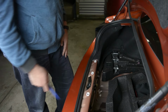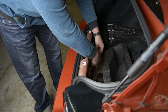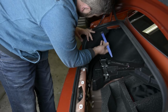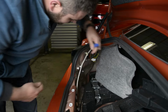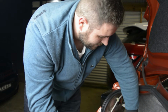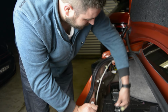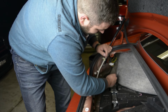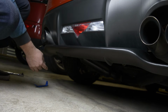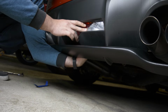That's it. Then where's our wiring harness? Right here. So how do we get that wire to there? So we've got to unplug this. Probably going to need to take these off too. It runs down there. That's it there. Oh yeah, coming up through there. So that little grommet comes on the new one as well. You squeeze the grommet to the size of the hole and push it through the hole. Because you're not pulling it this way, because the other side's attached to the light. So you're squeezing it and pushing it through so you can drag that end, the whole wire through. So once we've popped the cable out from the boot side and gotten the two clips and the two bolts out, grab this thing from the back, it just pushes out.